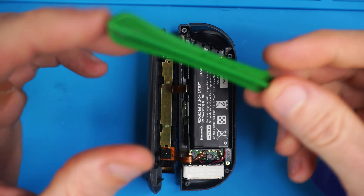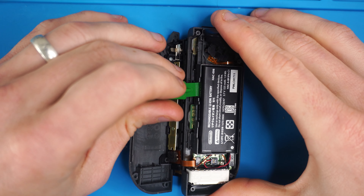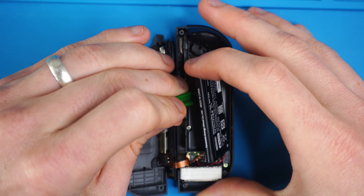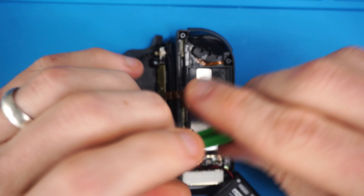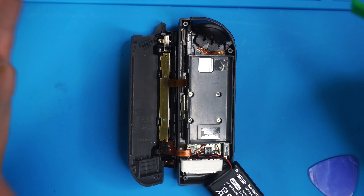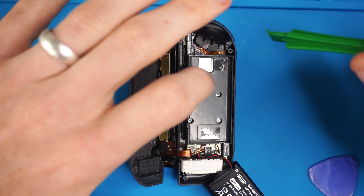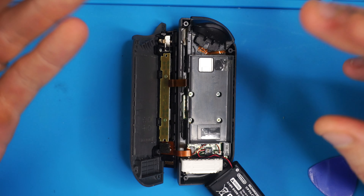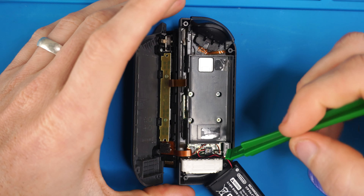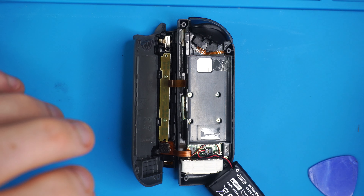Take your pry tool — there is a slot in the side of the battery where you can get a pry tool underneath pretty easily. Get it under there, pry up a little bit of that adhesive, pull the battery off gently and pull it out of the way. Previously I was removing the battery connector from the board, but it's just another step you have to reconnect. There's a small risk of shorting something out, but if you're careful you should be fine. A lot of people were complaining that the connector would break off of the board, so we're not going to do that anymore.